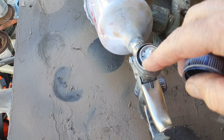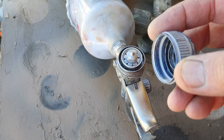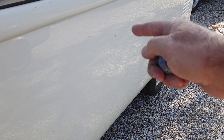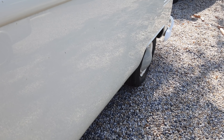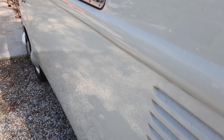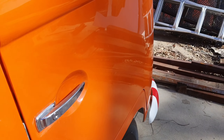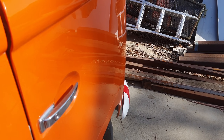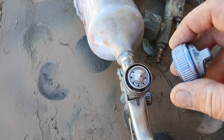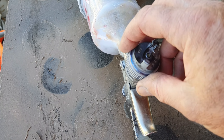You can see how this one has holes around the air cap. This is a pretty good gun — you can spray a car really nicely with it — but it's not going to be like a premium gun. If you're painting a vertical flat panel, like the side of a VW bus, you'd probably want a better gun. There'll be a bit of orange peel. On a vehicle like this truck it would work okay, but on flat panels any orange peel shows badly.